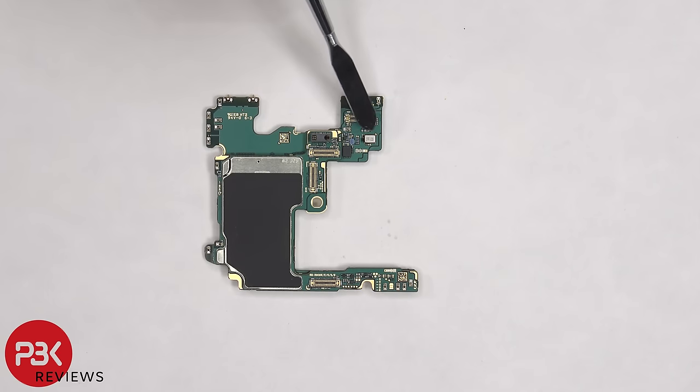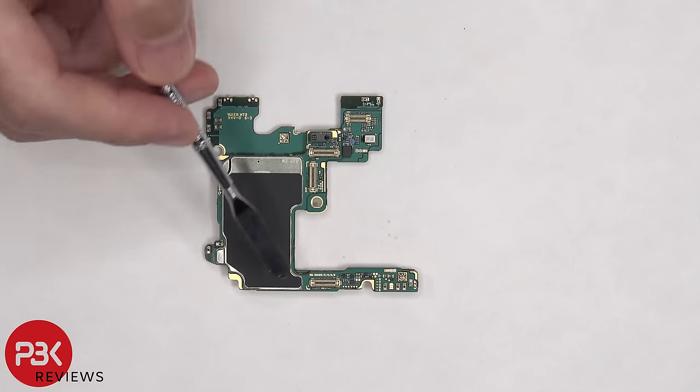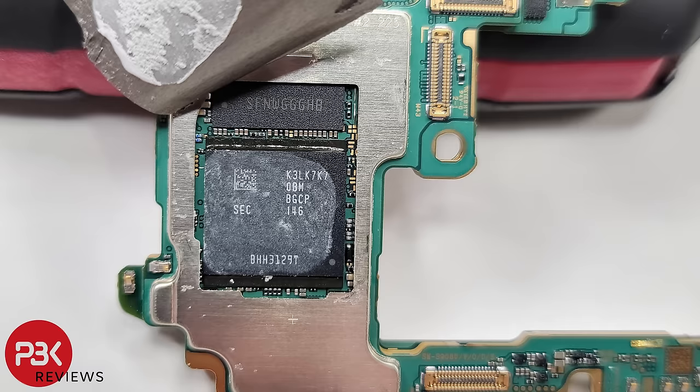The microphone for the back plate is located here and the proximity sensor is located next to it. There's also graphite film over the back shield. Once the graphite film is peeled off we can see thermal paste on top of the processor and RAM. This thermal paste is the new thermal paste Samsung refers to as the GELTIM or TIM — it's the same one used throughout the S22 series, and it's more evenly spread out over the chip. Here's a look at the RAM sitting on top of the Snapdragon 8 Gen 1 processor, and the ROM or storage located above it.